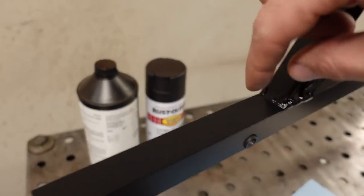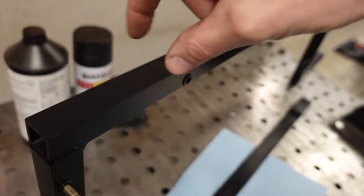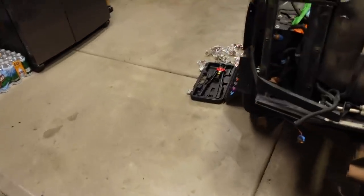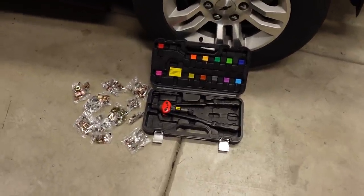I don't like using self-tappers if I can avoid it, and I don't like putting a nut and a bolt straight through the tube, because that'll kind of collapse it as you tighten it down. So for a factory look, I just went out and bought a riv nut tool off of Amazon, and I'll send you guys the link down in the description so you can check it out. I think this whole kit is like $75, maybe something like that.